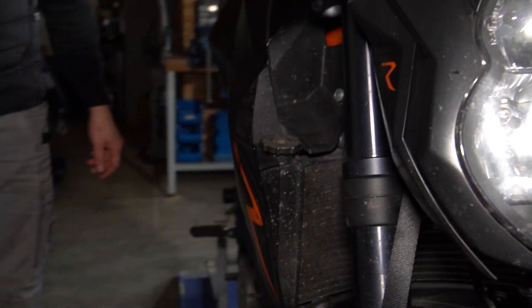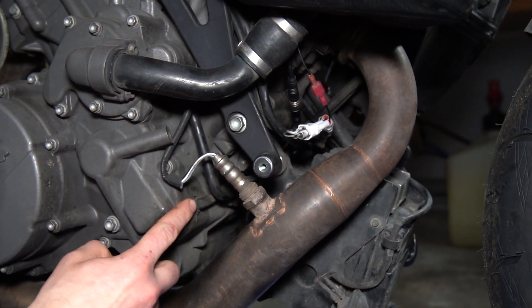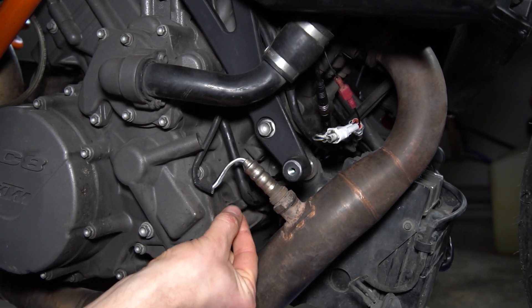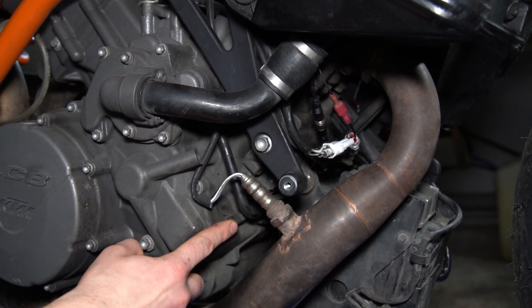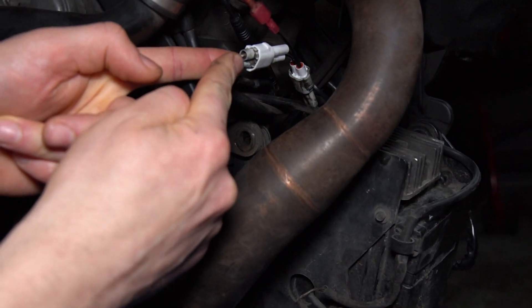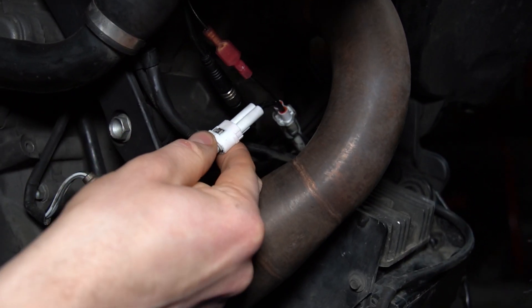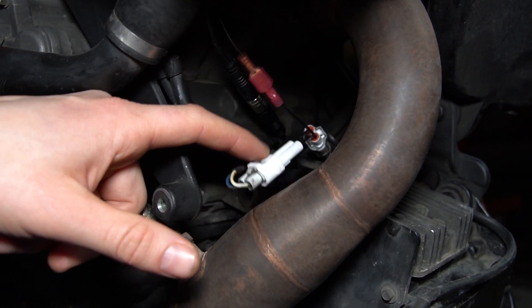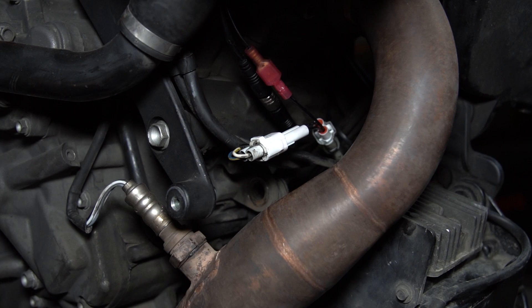So we go to the right side of the motor. There is a cable from the Kurbelwellensensor (crankshaft sensor). There is a rubber stopper here which you then have to remove, and you can follow this cable. It comes down here at the end, and this is a two-pin white Stecker (connector). In our set, there is an Abzweigverbinder (branch connector), also this Zwischenstecker (intermediate connector), which you just put in there, and then you get the Drehzahlsignal over the red connector.